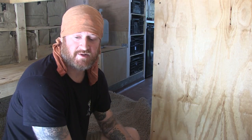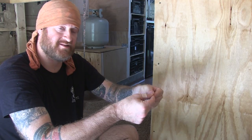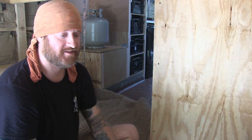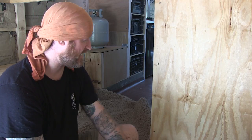So a pretty quick job on the carpet back here. I'm going to do the same thing all the way around. Really, really easy. You just lay it down, fold it where it needs to be cut, turn it back over, you see where the grid lines are, cut along those. For very exact cuts, use scissors. For kind of broad stroke cuts that allow you to do the minimizing later, use your box cutter or an X-Acto knife or something.